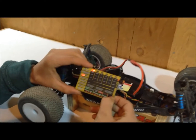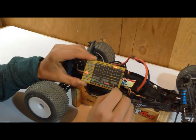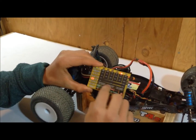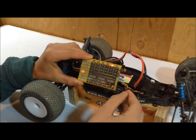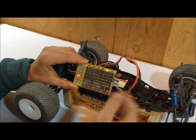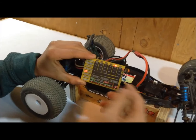A couple questions we've had: punch control is the amount the motor will accelerate. The more punch control you have, the less your motor will accelerate super fast. So, it's basically the traction control system, so you won't get wheel spin. You don't always want straight-out acceleration, because you'll get wheel spin.